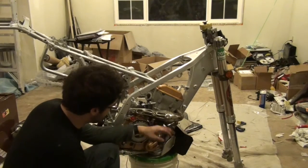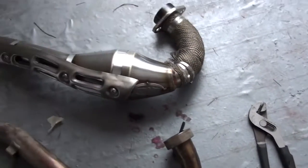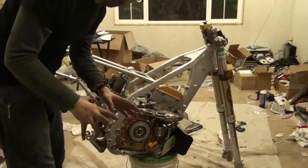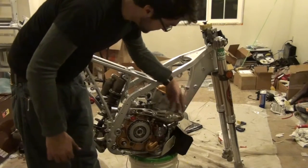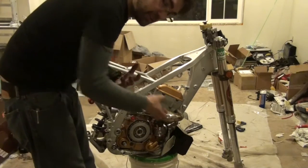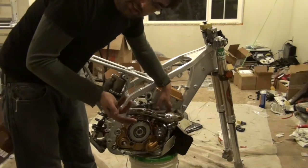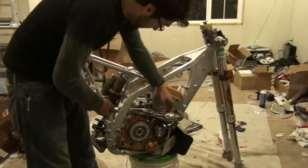The other company is FMF and their bomb exhaust. If you were to look inside this, the normal exhaust pipe continues through it and has a few holes drilled into it going into the bomb, just like it would be in a normal traditional stock muffler. The simplest way to put it is that it changes the way the exhaust gases flow depending on their velocity. If they're traveling very slowly, they will go into this bomb and get caught up, have more friction, and get stuck in there so there's still something to pull out that last little bit of gas. But if the exhaust gases are going really fast, it kind of just ignores the holes. Due to jetting effects, it's very hard to change the direction of particles traveling in a stream, especially if they're very concentrated and moving very quickly.